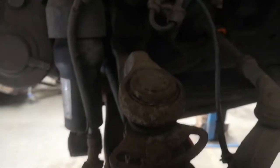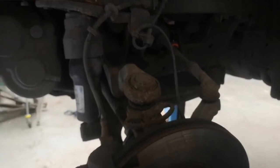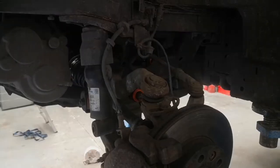I've got the driveshaft back in now and it's just reverse procedure: put the bolts back in there, bolt back in there, and then fasten the bottom ball joint back on. Last but not least, that bolt through the shocker, and then that's more or less done. I think in the next video I'm going to be replacing the brake hoses with braided lines. So if there's anything else you'd like to see, drop it in the comments. Thanks for watching.